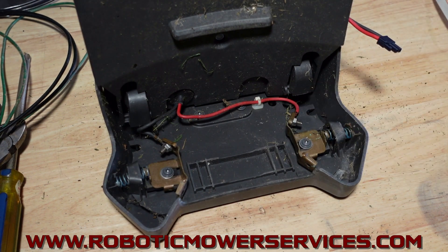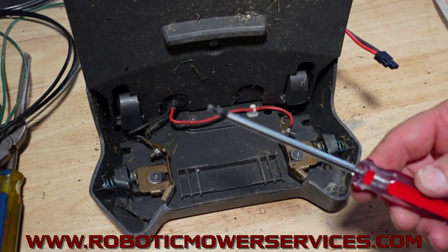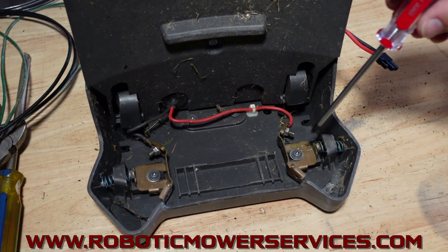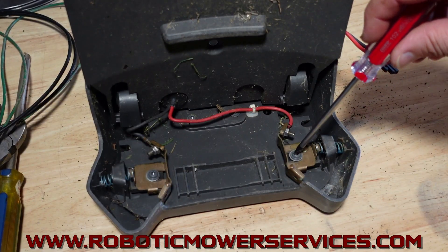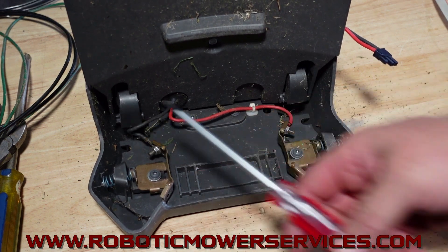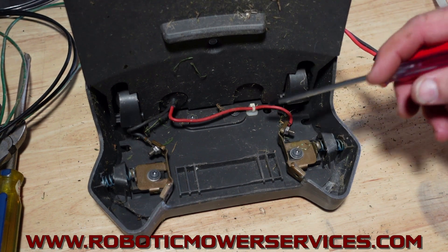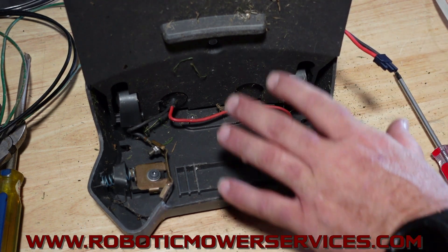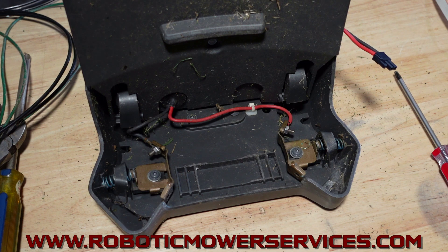Real easy to do — you don't need any tools or meters to check that, just reach up under there. If they move, that's it. Then it's time to get tools out. There's a screw under each hinge — take this top off, then take the charging contacts out using a T20 Torx bit. Take those screws out back there too to get this top off. Back to the T20 — take those out as well, including the screws that hold your ring terminals in. Take it all apart, clean the terminals and wires up real good, make sure everything's in good usable condition, then put it back together and tighten it up so you have a good solid connection.